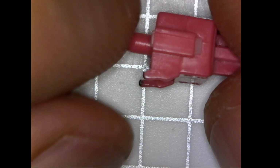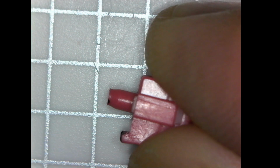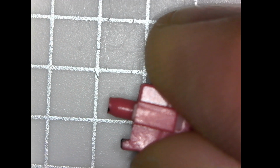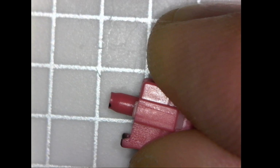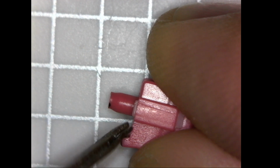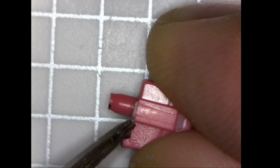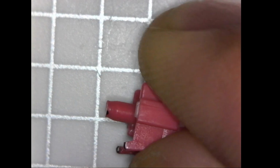If Zeal decides to do another revision of these to try to fix that issue, maybe he could think of a way to solve that. Maybe, for example, this place where the cushion is at the bottom, if they don't want to make the cushion bigger because they don't want it to be squishy, then maybe they could make the plastic extend farther down so that the cushion still protrudes the same amount from the plastic, but then the plastic body of the stem itself extends farther down towards the bottom of the housing. That's one idea. But hopefully that'll clear up, in case you're wondering why these switches are not as silent as you might have expected them to be.